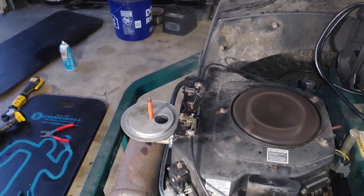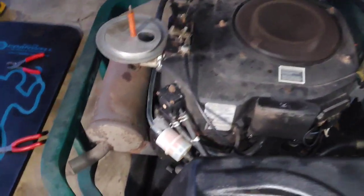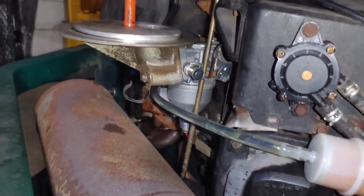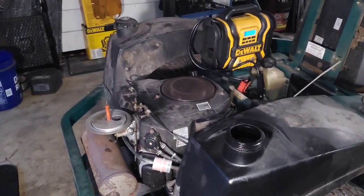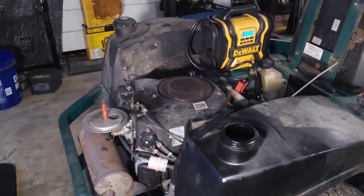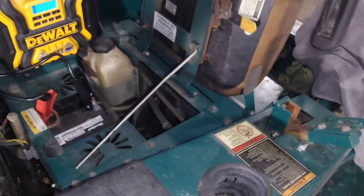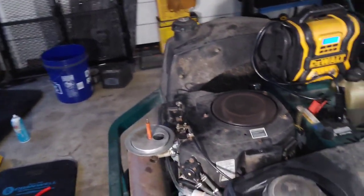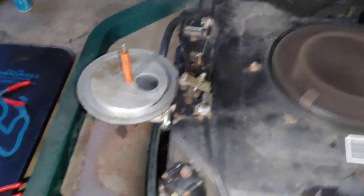I got it cranked up, and when I took that carburetor off I accidentally broke the fuel pump - that's why I was running the line right there. But I noticed once I got it running that gas is coming up shooting at a very rapid pace, high velocity. That made me think the intake valve wasn't fully shutting. I was having to run it off my battery and had a dead battery, but I'm going to show you the amount of gas - I was starting to get concerned it might backfire and shoot flames, so I cut it off pretty quick.